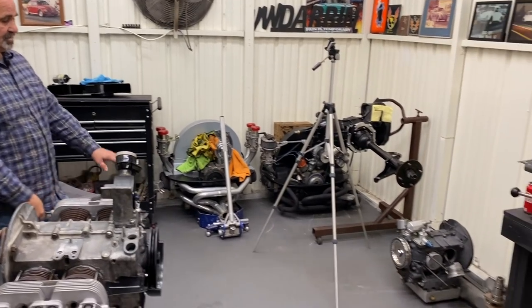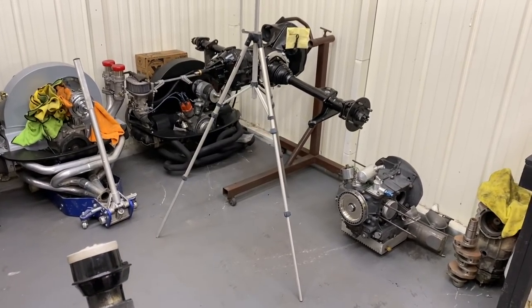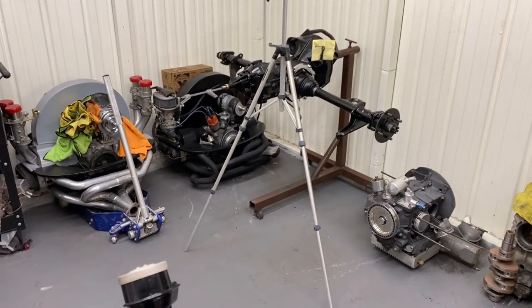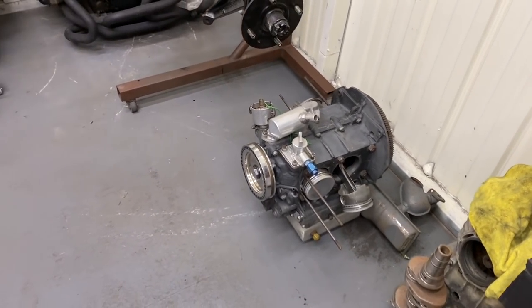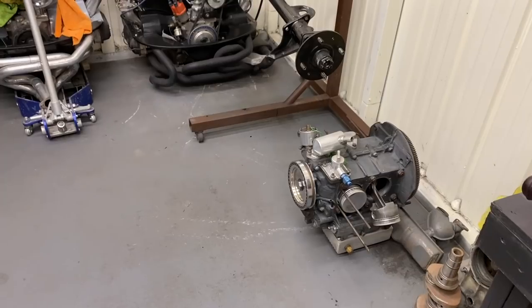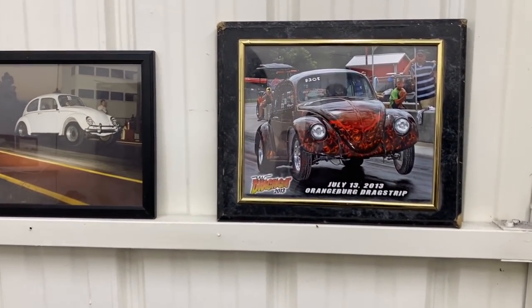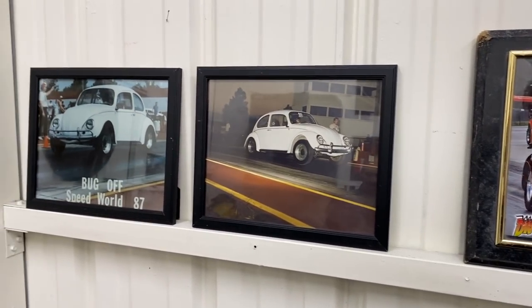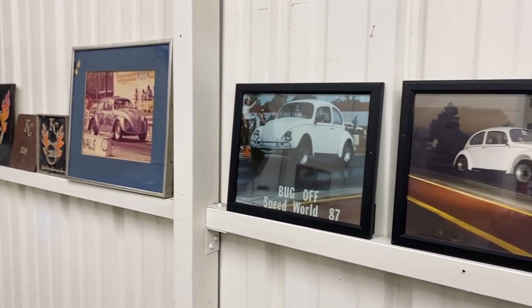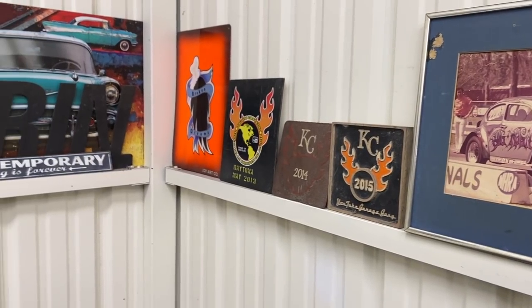No, like this, the turbo motor right there is a good example. They're similar in size, but the quality of the parts is a lot different. So this has an MTI crank in it, where the race motor has a Scat billet crank. And if you're building a street motor and you only want to make 150, 160 horsepower, which is a lot of power, you can get away with the parts that are available now. If you're going to drag race it, you're probably going to want to call Scat and maybe get some good rods and design your motor for the higher RPM. Some of the race stuff, we turn like 10,000 RPM, so the parts have to be really good. But on the street stuff, we try to keep it about 6,500. Gotcha. The parts hold up pretty well.